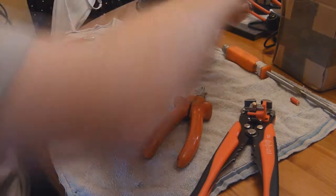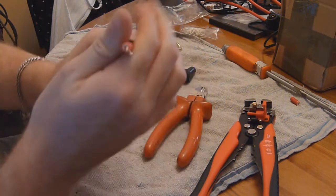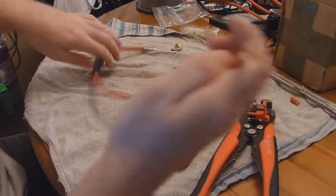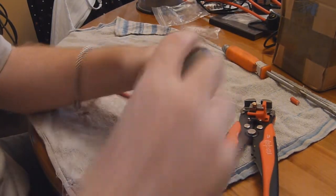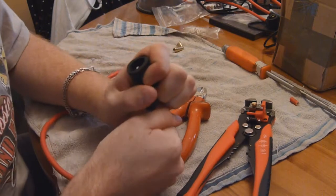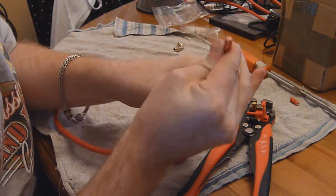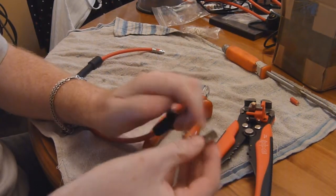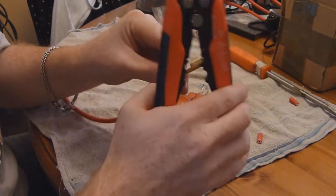Before we forget, you also have to feed on the plastic ends first - because if you put both ends on and don't feed these two insulating boots on first you're up the creek without a paddle, more so if you've glued the ends in. This one's a bit harder because you have to go through a 90 degree angle and get the cable up through there, then just push and pull it out a bit more. For the distributor cap side it's exactly the same - just get your little connector and put the cable into the connector.